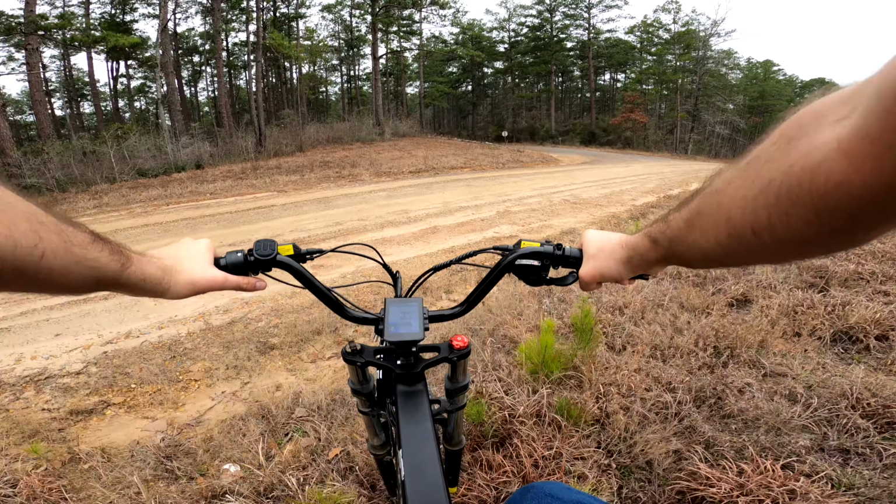The power switch on the main battery pack is also an unnecessary complication when you consider the bike's internal battery does not have an on-off switch, meaning that it's always active when the bike is turned on. This has led to many rides where I've forgotten to hit the button hidden under the seat to turn on the main pack and drain the internal pack first, which might not sound like a big deal, but the bike's internal booster pack is a range extender not intended to take the full load of the motor at only 10 amp hours. So I'm sure I've put unnecessary stress on this pack many times simply because I forgot to turn on the main one.